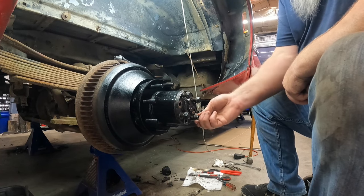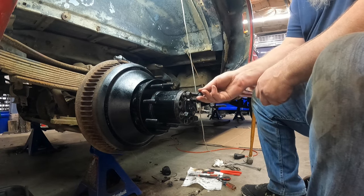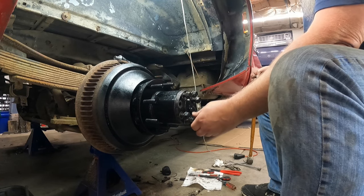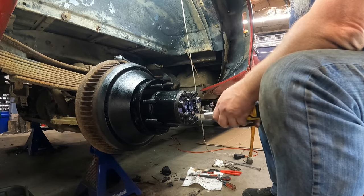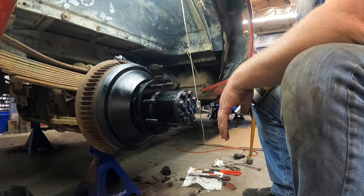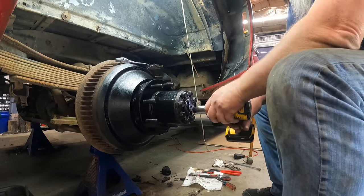I took these bolts and gave them a good scrubbing so they were clean. Also, the previous person had basically filled up the thread bottoms on these guys with sealer/gasket maker, so I cleaned all that crap out too. Now we can run these on in. I just ran those in but haven't torqued them yet - I'm not sure of the torque spec and I'll look that up. The axle flange bolts are torqued to 115 foot-pounds. Since it's just me, I'm going to set a little pry bar in here to keep my wheel and hub from turning so I can use the torque wrench.